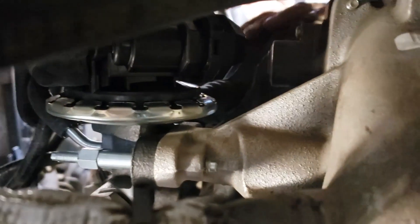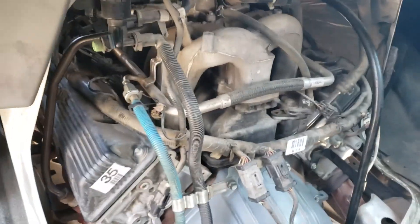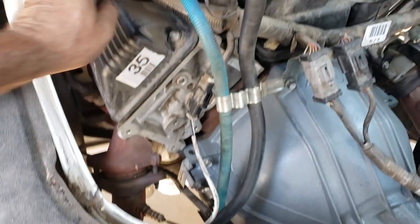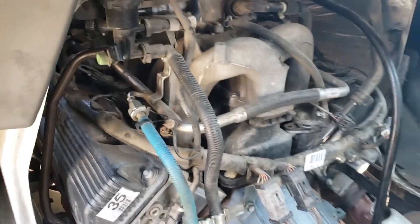It's starting to get a little warm out here for us. There's the new part — new EGR valve and sensor combo. As long as there's nothing wrong with the computer, it should take care of that. It wasn't so bad. We took the doghouse off, were able to get the wrench on the exhaust pipe, two bolts and it came off.